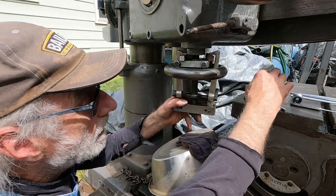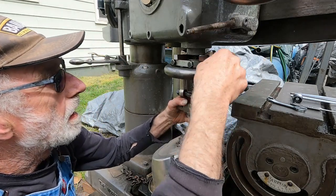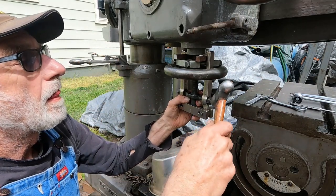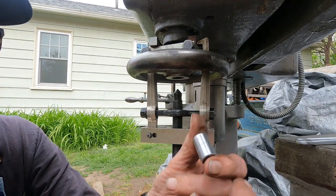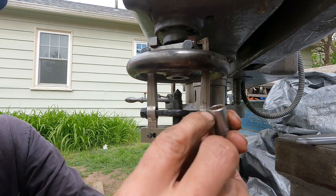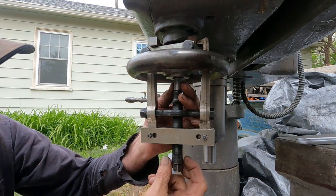Maybe if I snuck this up some. I'll have to get another bite on the puller — I'll go find some stuff to do that. I found an old Proto 3/8-drive 7/16 socket that's got a crack on it. We'll use that — I'll put the crack down. Should fit that point. Let's see if we can't get this the rest of the way off.